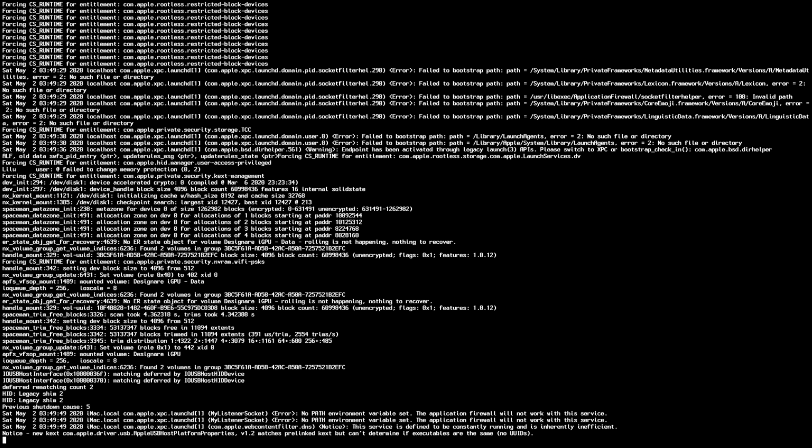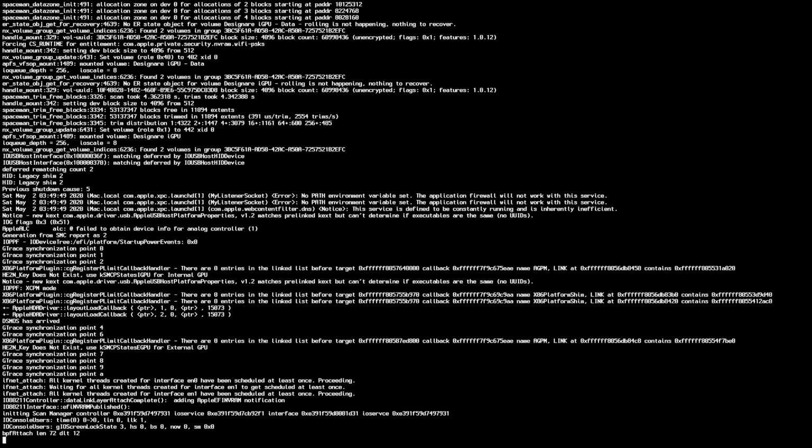And guys, it'll get stuck on a couple of lines, but nothing serious on this one. It moves along. And we're going to get up here to our first screen where we can use our disk utility and erase the hard drive. Get it ready.